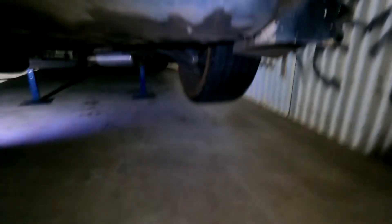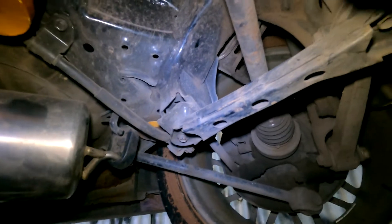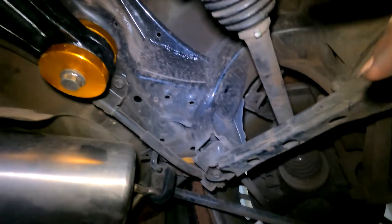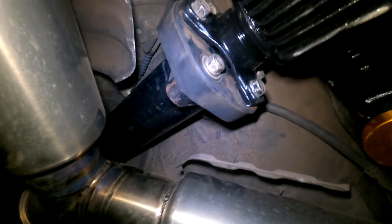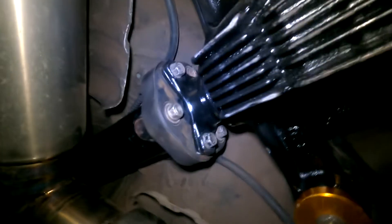Sorry about it - put it all back together pretty much off camera. I am grubby as hell, it got pretty quick. New diff in, tail shaft's in, exhaust on. I didn't swap the axles out so they can just shit themselves whenever they want. There is a bit of slop in them but I've got more axles and I can change it later on. Remember how I showed you at the start of the video how sloppy the backlash was in the old diff? This one - I can't even move it. Jesus Christ. No more backlash - should be hell of a lot better to drive.